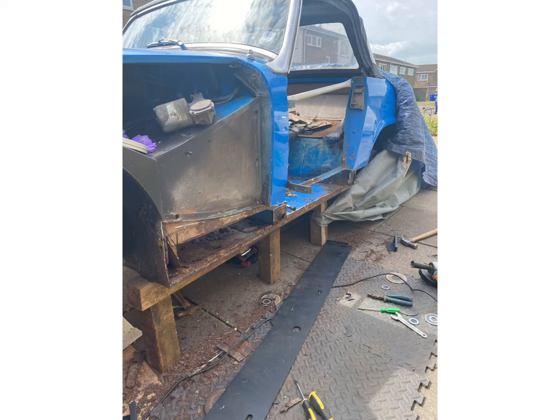This is one of the biggest parts we've welded so far — the first sill we replaced. The inner sill was quite rotten so we replaced it. This is when we cut the outer and inner sill; this is what it looked like. The bit that goes underneath the door we tried to keep for strength. We braced the door opening when we took the door off and reinforced the bottom with a wooden pillar, which worked quite well.